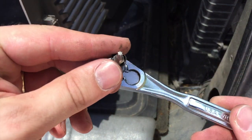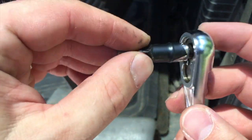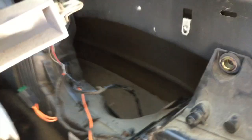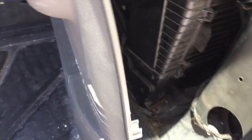I took my quarter-inch drive, found the T15 Torx bit from my screwdriver set, and taped it to the quarter-inch socket with electrical tape so I don't lose it. I'm going to attempt to unscrew it one-handed by sticking my arm back behind the case. I also loosened a 10-millimeter bolt here and another there to give the case some freedom to move about a quarter to half inch — hopefully just enough to get my hand in. I apologize for the poor camera work; I'm sticking my phone down there to try to record in pitch black.